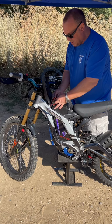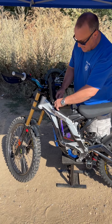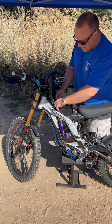The battery uses two leads to share the power. This is the original for the lights and everything. And here's the main one, which is a big QS8 connector with a big 6 AWG wire to handle all the extra power. This bike is running at 18kW in race mode.